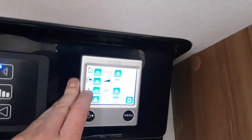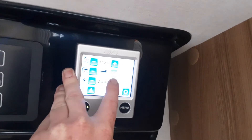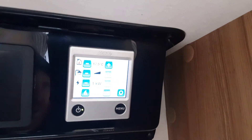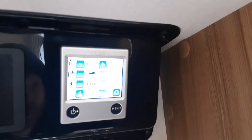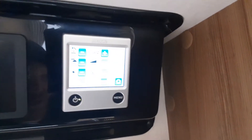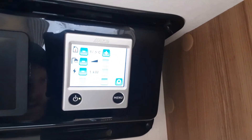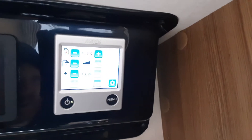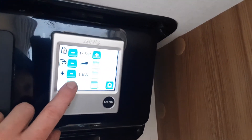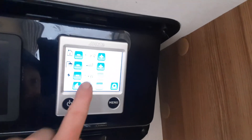Below that you've got the mains power coming into the caravan. Depending on what site you're on you'll either have one, two or three kilowatts of power available — here on site we've only got the one kilowatt. If you want to run the heating and hot water on gas, you can simply press the gas button in the bottom left hand corner of the screen and that will ignite the system on gas. If it fails to ignite it will come up with a gas fail at the bottom of the screen with two exclamation marks at either end. To turn the gas off press the gas button again, and to turn your water heating off put the bar back down so it's completely empty.